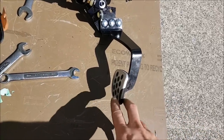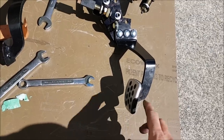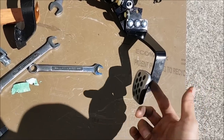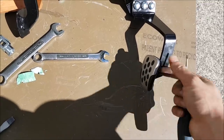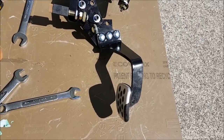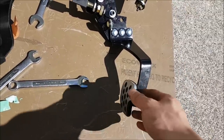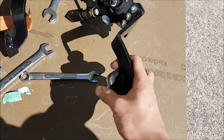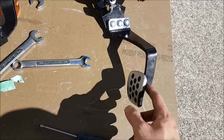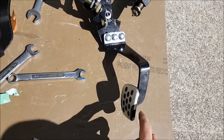To put on the original clutch pedal pad, it will take a little bit of wrestling — it's just a rubber flange on the back that holds it on. It's tapered up top, so I started from the bottom, squeezed it out as much as I could, put silicone lube on the inside, and basically just pried all the way around to get it over the new assembly. You definitely want to put this part on outside of the car. Don't try to slip the pad on after — it's too hard. You don't want to do a half-assed job and not get the top on well, because while you're driving it can pop off and you lose your grip on the pedal.